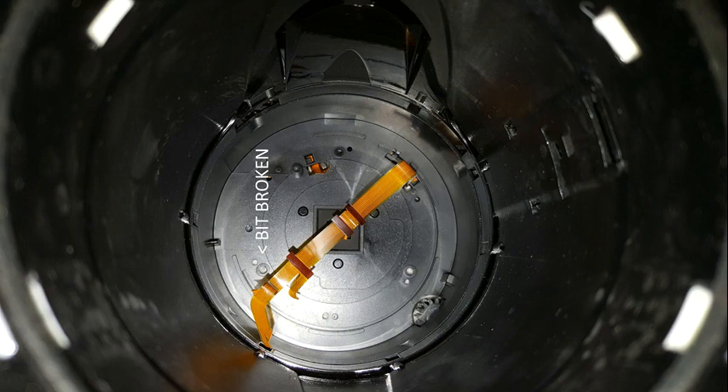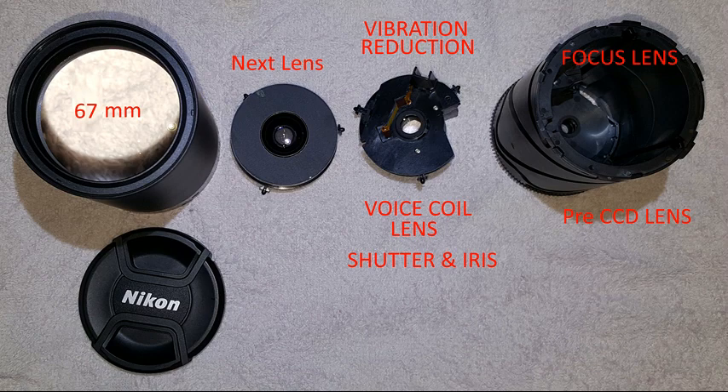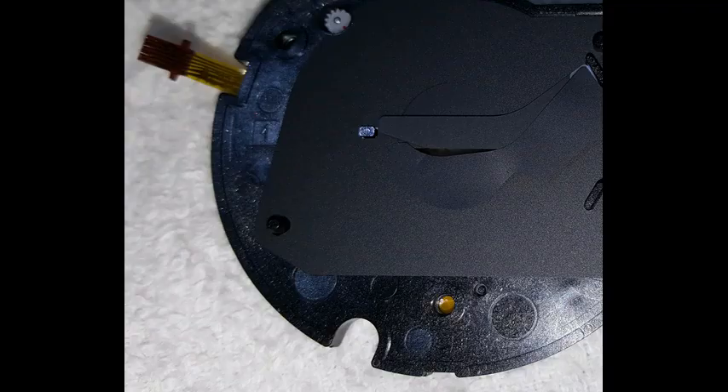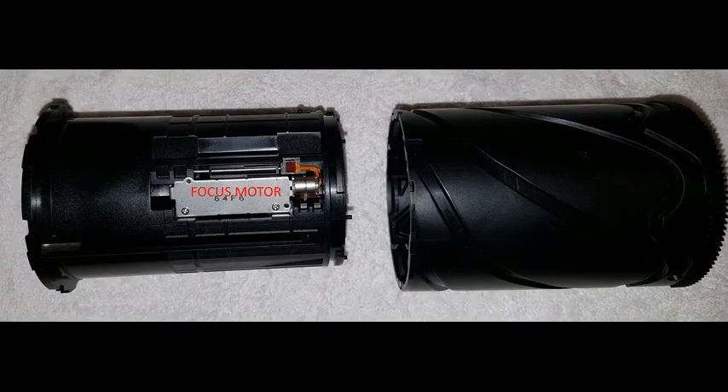Now that the lens is in four parts you can inspect and fix as required. Looking down into the barrel I can see where the FFC leads are broken — that was not good to see. The aperture and shutter assembly are joined to the vibration reduction lens by one screw and two clips. Inspecting the shutter and aperture showed signs of jamming — one leaf appeared bent and stressed. I dismantled the shutter first; the four leaves popped right out and the aperture leaves followed, creating quite a puzzle. There is a visible crease in one leaf. It appears the shock the camera experienced caused a leaf of the shutter and aperture to become entangled, so the shutter could not open and all photos were black.